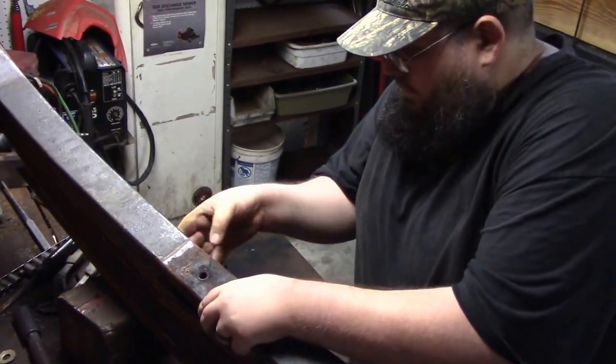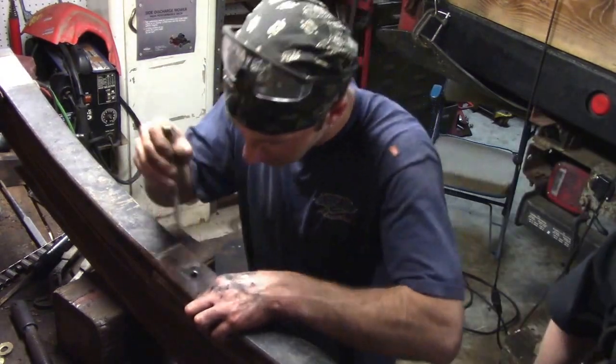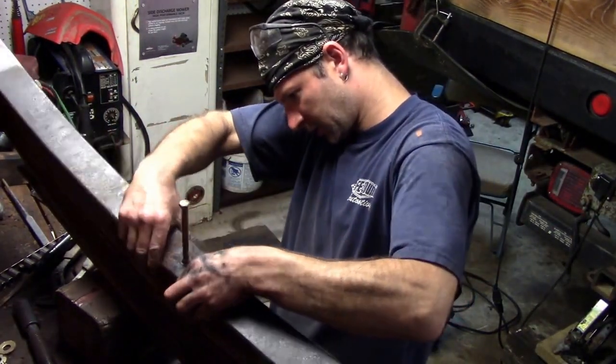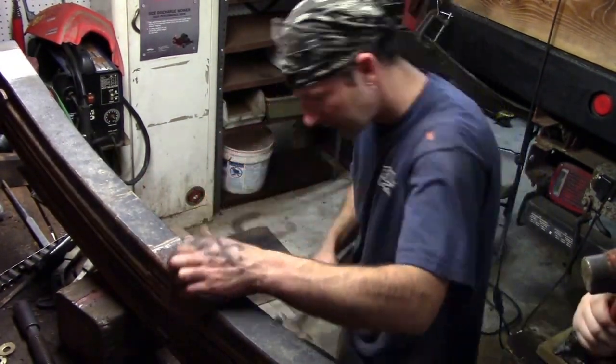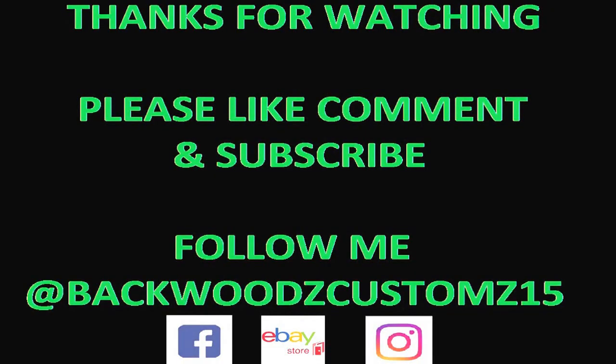Here you can see a spacer — about an inch — and then the overload. You can see at the upper left of the screen where it sits on the perches when it makes contact. We're just putting a bolt back in that we found, because we didn't have one long enough for the whole assembly — we put the proper one in later. It does not have to be a centering pin; you can just use a bolt. If the bolt head is too big, just round it off.